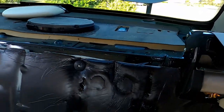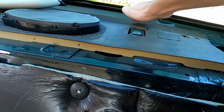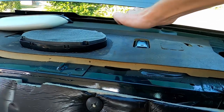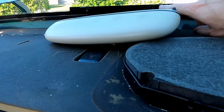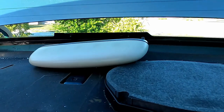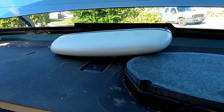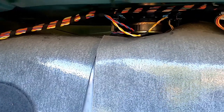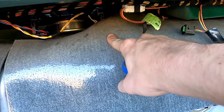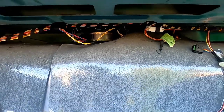It wasn't too bad — the undermat starting to pull forward was just the back edge catching on it a little bit. I reached in and poked it down, which let the top cover of the package tray come up and over. Your third brake light you'll probably want to lift off the mounting tabs on the rear window, which should slide up and off. Mine is missing those tabs and was at one point glued on. I was able to get the blue and red wire plug off easily, but the yellow and white wire has the mat pressing the clip in place, so I'm going to unscrew the subwoofer screws, lift that up first, and then unclip that wire.